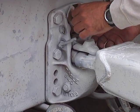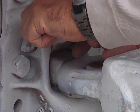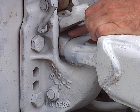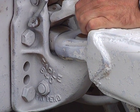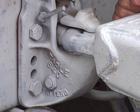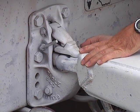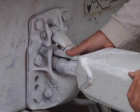You'll notice now the plunger is in. We'll zoom in and show as I lift the locking mechanisms up — there's the plunger. It doesn't want to come up. It's a third system to hold it in place. This plunger, which is holding against the I-hook, is also keeping the locking latch of the internal hook from wanting to come all the way up. So there you have it: you've got a plunger, a locking latch, and a safety latch onto that other locking latch. There is simply no way in normal operation that this mechanism is going to come loose.